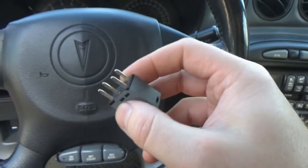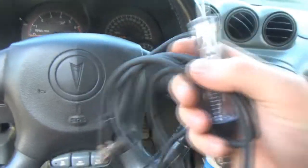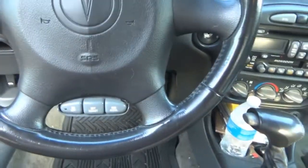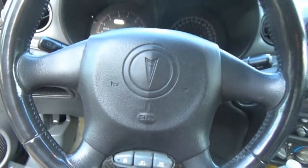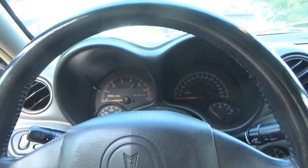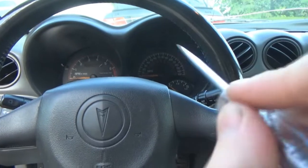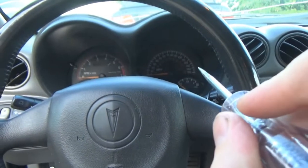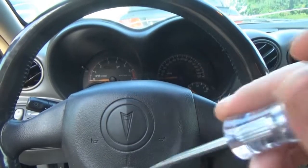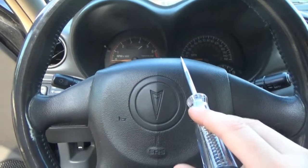So what we're going to do is, I got this relay out, and we're going to go under the hood and use our little scope on a rope that I brought home from work with me today. I tried looking for an exact pinout of the relay, what's control side, where our powers are, and all this stuff, so we're just going to do it like this. We're going to find all of our powers first that control the relay, then look for our grounds. And one of the grounds is going to end up being the control side, which will be the switch.